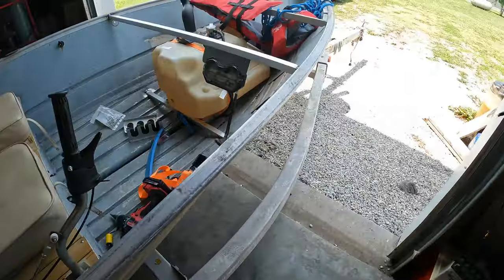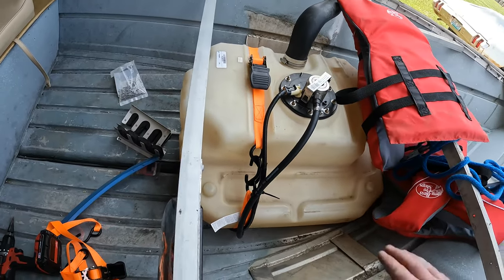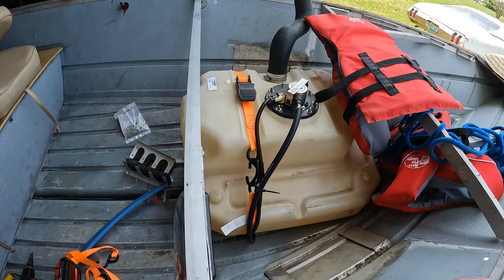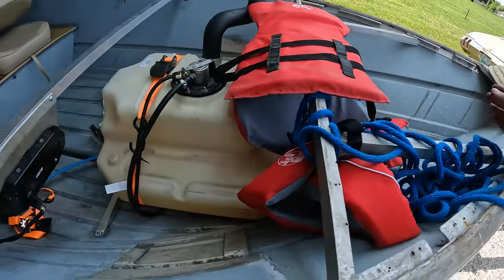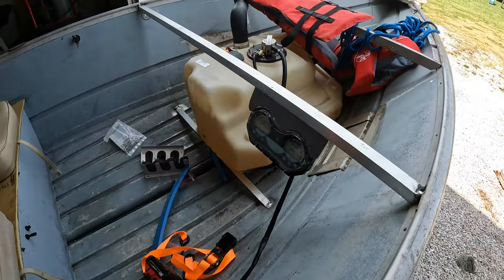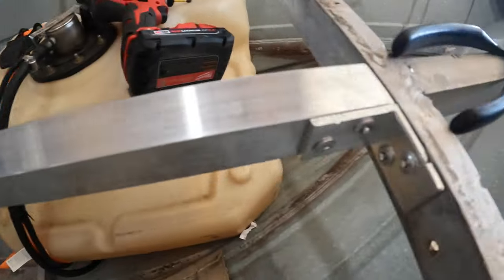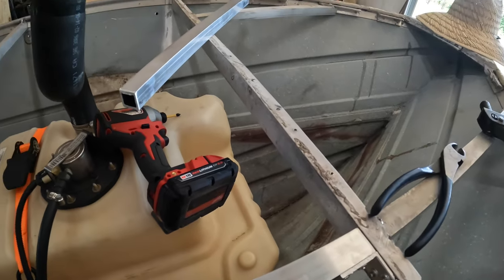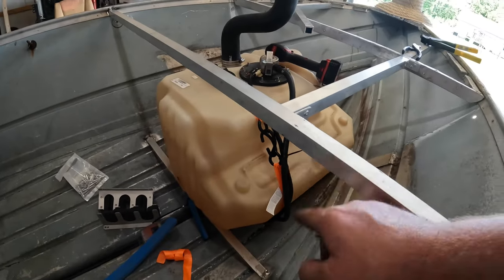Now I'm going to start working on the front part, getting some aluminum cut. I'm going to run a brace across here and then two pieces — one on either side of the filler neck — so I can cut the filler neck down. When I cover this there will be a little door to put gas in so it's not sticking up. I'll probably put one in here also to brace this up, and then run two uprights, one on either side of the gas tank, to solid that bar up a little bit. Got my first brace put in with the angle riveted into the corners — feels real stout. I'll go ahead and get the other one in and do the uprights.